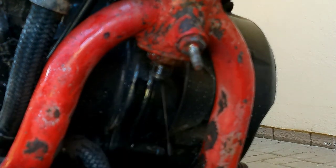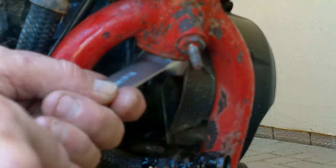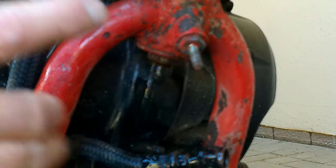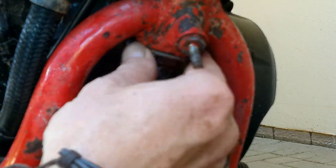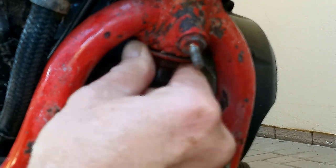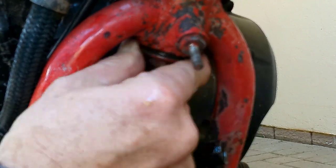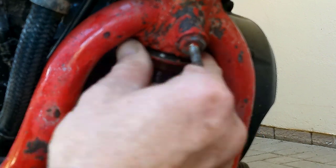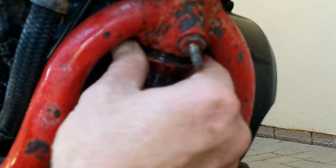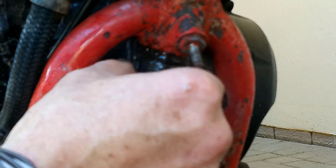Right, the oil is drained. Now we need to remove this bolt. It's a number 19 socket. Now I have, before the video, just got it cracked loose. This was very, very taut. That only tells me that I don't think anybody has ever removed this. Well, hopefully it's not going to be full of debris, but we'll see.